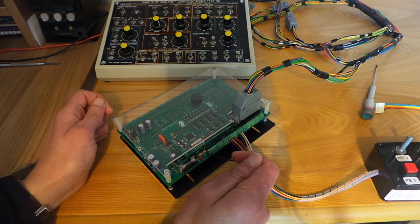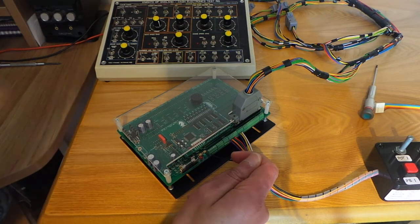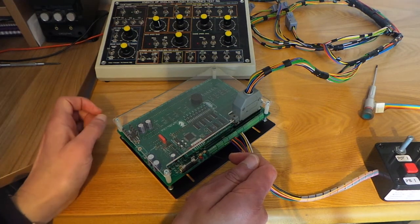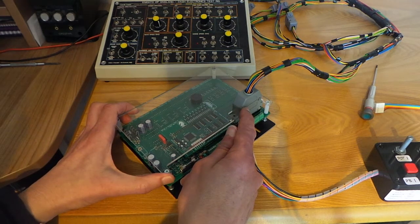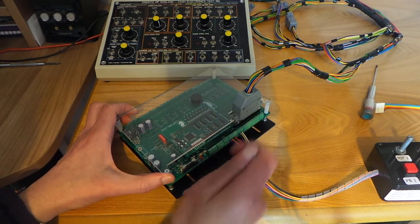For UK legal requirements, we have a requirement for an indication of the state of the rear fog lights. We accommodate that on pin 10 on the D-type connector or terminal block connector pin 13.